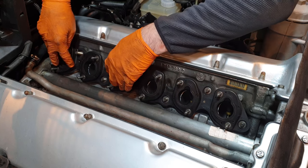If you don't want to pay over 100 quid for original BMW cabin filters, the Mann CU 3037 filters work — just cut them lengthways and they slot in no problem. They're only 24 euro, very cheap. The original engine acoustic cover isn't in bad condition but needs a bit of cleaning up — and these are NLA from BMW, so let's do a quick refurb on it. And now the final piece goes on.